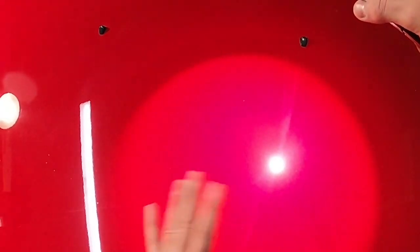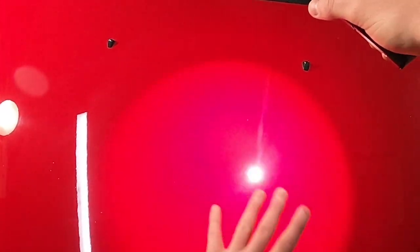So once we see those little kind of micro swirls, we know we're on the right track, and that's when we're gonna switch pads to a foam pad, and then the foam pad is gonna refine those and remove all of that. And so I'm gonna switch the pad really quick just as my test spot, just to see how it turns out. And I think that that should be our go-to method for the entire car.